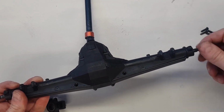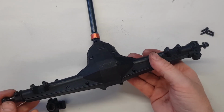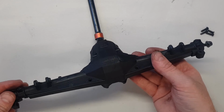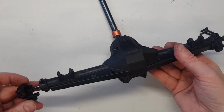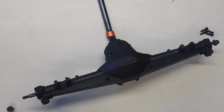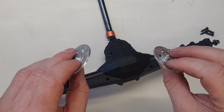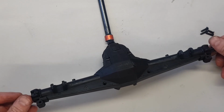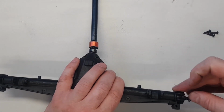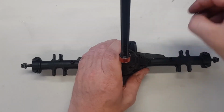So that then just goes over kind of the wheel nut on, like that. Put the wheel nut on so I don't lose it. Wheel nut on, sorry, the bearing holder there. These, my next job, I've got to just straighten them out. You see they're pretty well bent, so that will be another job. I'll do that towards the end. I'll get everything back on the car. Just gonna put those nuts on there, and then you've got 4 screws. What are they, 12mm, which just go through the back of there and there.